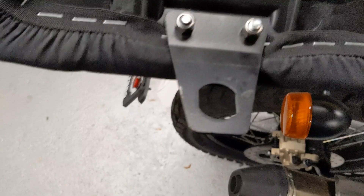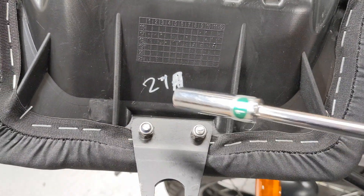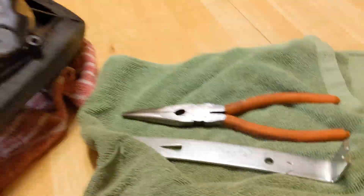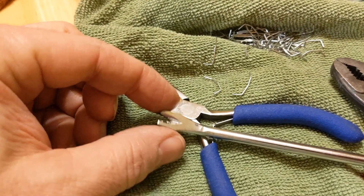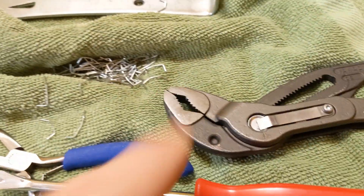So you've got the seat off. These have to come out and you'll do that with a number 10 millimeter. Take this off and then these staples will have to come out. Once you have all the staples off — and there's the mound of them — all I used was this tool; work it from the side. Don't try and use it like a pry bar. Get the staple in on the side. All you've got to do is lift one leg and then use a tool like pliers, anything to get the other side out.